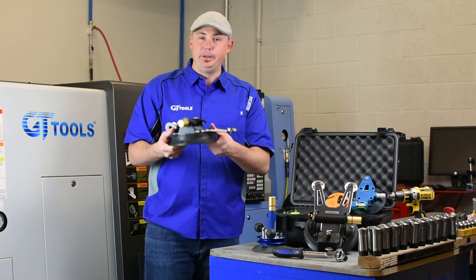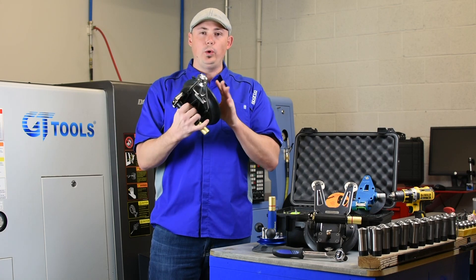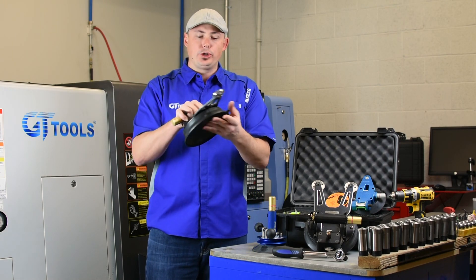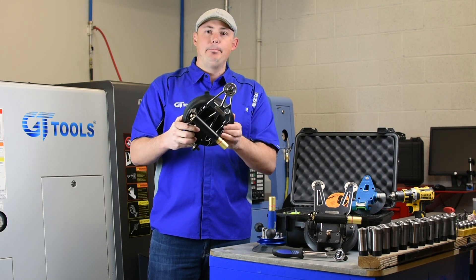As you can see, this guy is a beast. It's built off an 8-inch curved cup. That design is meant to hold and seat this tool to the glass without it pivoting, sliding, or turning on the glass. It's great for cutting out windshields, some quarter glass, and back glass.